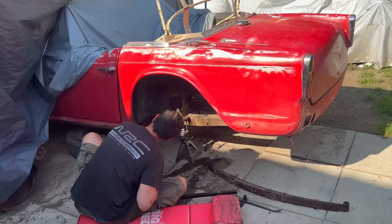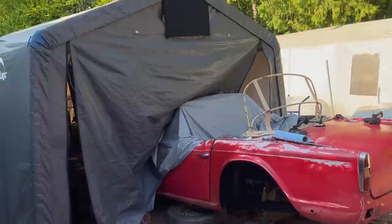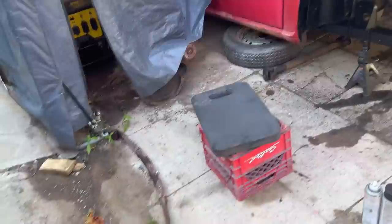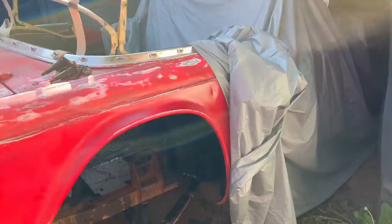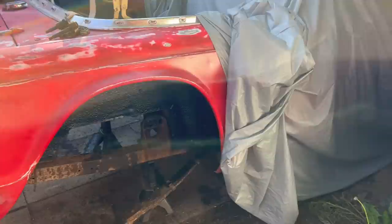Sure. Okay. All right, it's just coming up to 6:30, and we're giving up because we're stuck, right? Quite literally. We're literally stuck. So this spring came out okay, and Elena rejoiced, and the celebrations were a little bit premature, let's just say. The passenger side is stuck pretty solid. So we've stripped it pretty much of everything that we can. The shackle at the rear came off, but that spring eye at the front is holding tight. So we've sprayed it with some more penetrating oil, and we're hoping that's gonna do its magic